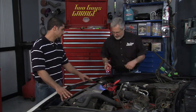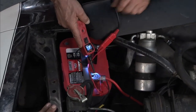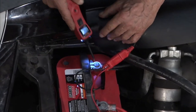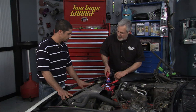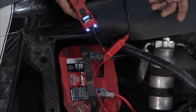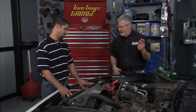Without that, you can't — well, here's the neat thing. We've been playing with the positive side — you can see right here that the little red light is on. If you go to the ground side, you get the green light. Now with the audible tone, high pitch is positive, low pitch is ground. So when you get to a place where you're probing and you can't see it, you can hear it.